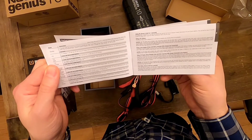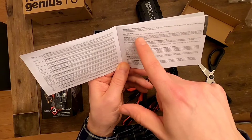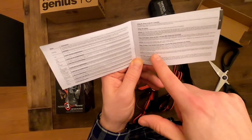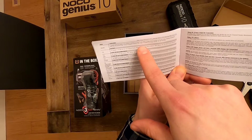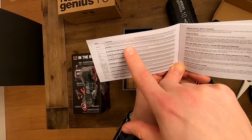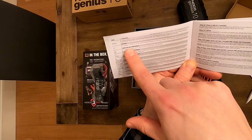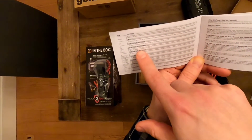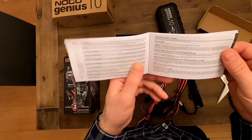Reading the instructions: force mode — press and hold for five seconds. You've got different modes: six-volt, press and hold over three seconds for 12-volt lithium batteries, and press and hold for three seconds for 12-volt repair. Standby mode means the charger is not charging or providing any power to the battery — energy save is activated, drawing microscopic power from the outlet. In standby, the orange LED will illuminate.